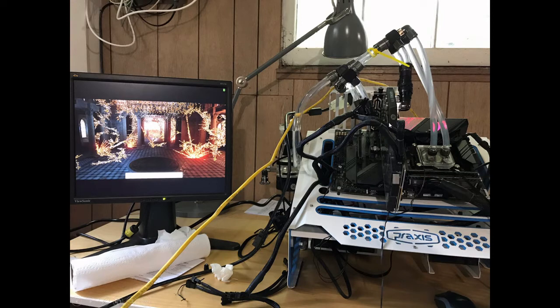Here I'm doing a test popping off the disconnects. I'm running a single GPU test and a benchmark — the 3D Mark Time Spy Extreme. What was happening was just a few tiny drops of water would fall on the motherboard. It didn't fry the motherboard, but your motherboard just does not work with the tiniest little droplet of water on it. I was sitting there trying to sponge off any small droplet with paper towels. Huge mistake. Putting anything that can leak onto your motherboard is a huge disaster.